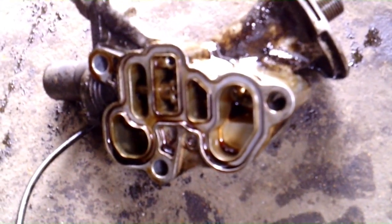Here's the actual adapter and the new gasket. Clean it up and the new gasket will pop in there. That's the new gasket with the screen. You have two electrical connectors — one on the bottom and one up towards the top, which is an oil pressure sensor. Pop those two out, then the three bolts, and this comes out. We're going to clean this up real good, put the gasket in there, and reinstall after we clean the block up.